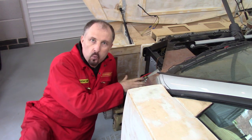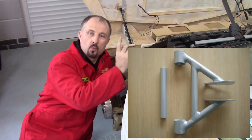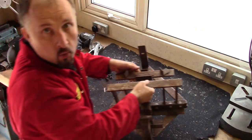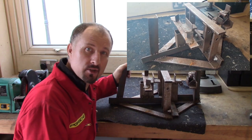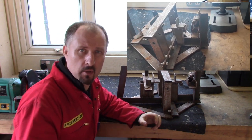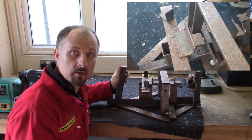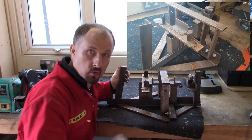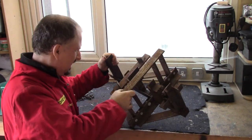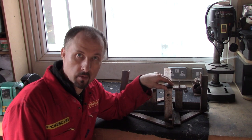One of the things I decided to do was make the wishbones — the upper one and the lower one — the same for both sides, so the lower wishbone is the same as the one on the other side, same for the front. To make these wishbones I had to use a jig. I know this jig doesn't make much sense to watch, but the point is you can't really make wishbones for your supercar on a bench — you really do need a jig. You have to get them absolutely accurate. They should also be made out of seamless steel, and it's preferred to TIG weld the joints rather than MIG weld. It's been sitting in my attic for a few years so it's got a bit of surface rust and it's quite weighty.